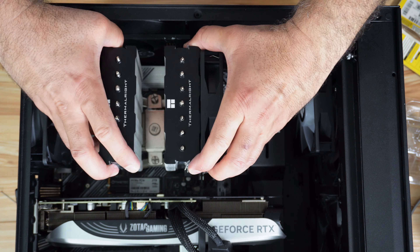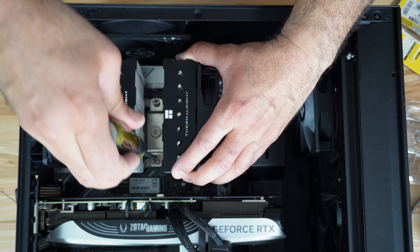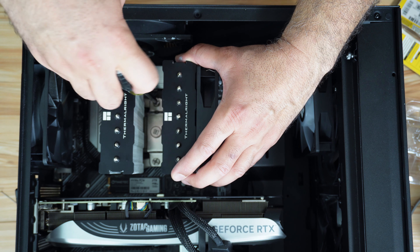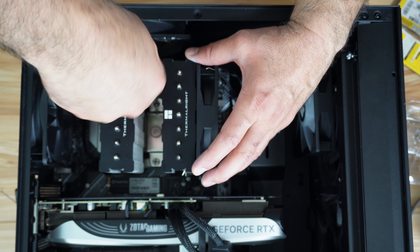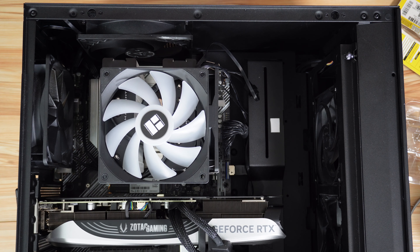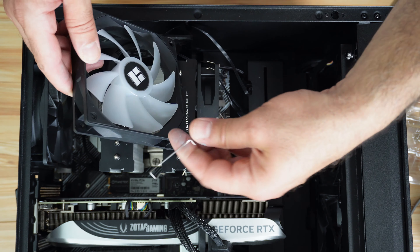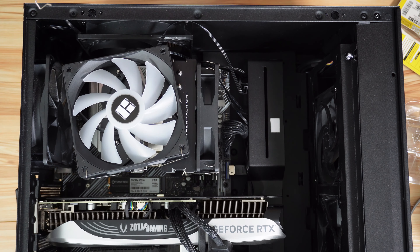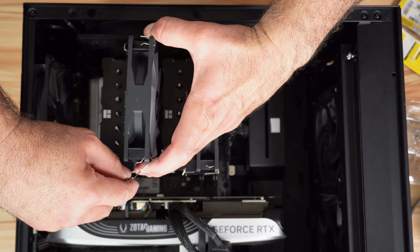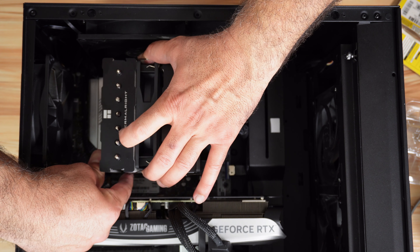You don't need more than this. Now I'm going to install the CPU cooler. Once you place the cooler on the CPU, try not to move it anymore so that the thermal paste will be well distributed. Tighten the screws a bit on the top and a bit on the bottom. As soon as a screw stops turning, stop tightening — do not over-tighten. Now reinstall the fan in the middle, making sure it's in the right direction. Put the brackets in, slide the fan while holding the brackets so they don't fall, and once the fan is in place, put the brackets into the CPU cooler.